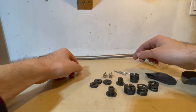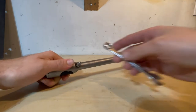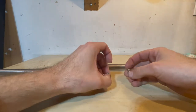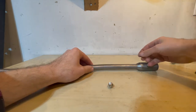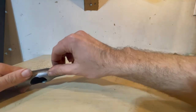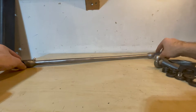First we are going to take off the old zerks from the drag link, as we are going to replace them with new ones. We'll just loosen them off. With the two new zerks, clean out the hole a bit and thread the new ones in, then tighten them down so they're fairly snug. The zerks are now installed.